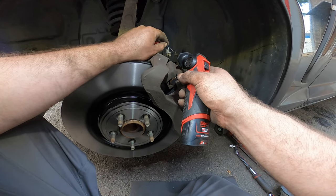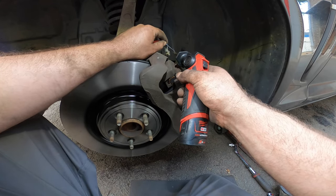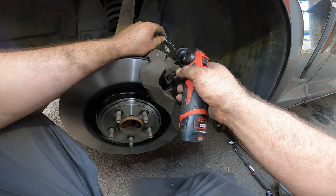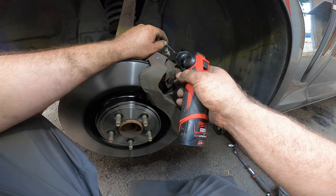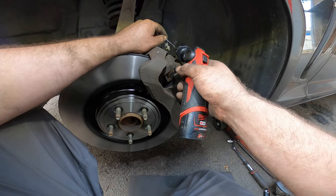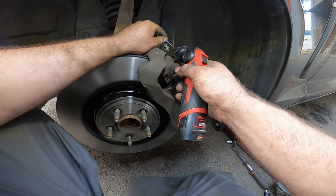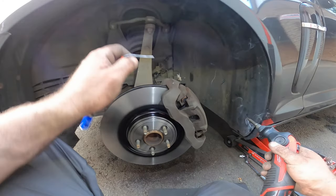So get a little bit of solder on your soldering iron so you can make a heat bridge between the wire and the soldering iron. And then you can melt the soldering wire into the wire, so it flows through the wire. Perfect.